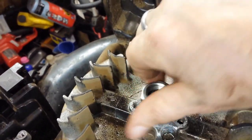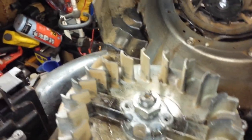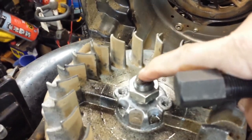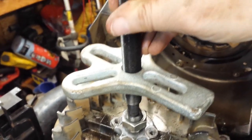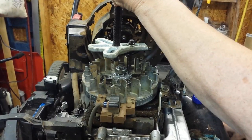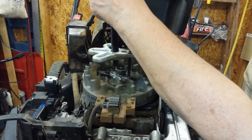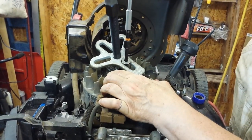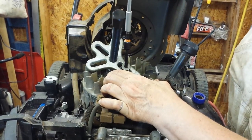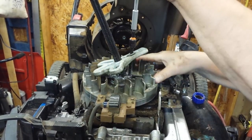I'm going to put the nut back on, because it should pop off with a pretty hefty amount of force and I don't want it to go flying across the shop. You'll note that there is an indentation right in the middle of the crankshaft, which should match up with some sort of indentation or tip on whatever your puller is. You want to thread the bolts in as deep as you can — hopefully at least as deep as you've threaded the hole — because that's what's going to keep this thing from flying out. If you only grab just a few threads, you might just shear it right out, because this is aluminum.